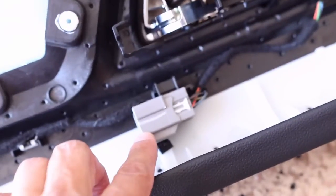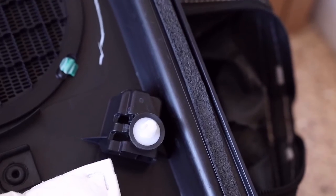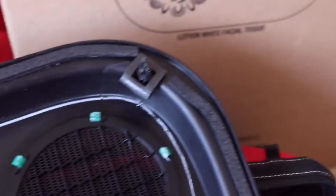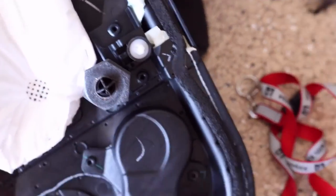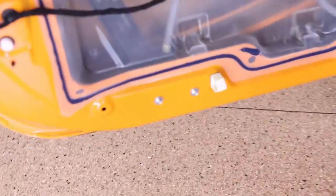Here's one cable assembly which looks normal. But this other black one is kind of deceiving — you see this housing that looks like where you push, but it's not. You have to push the little tiny plug on there to pop it out. Those are the little white clips I was talking about — there are four of them. If you put your tool in between the door around where those things are, you can pop them out. Just be careful so you don't break those clips — you've got to pry with a little bit of force and a sharp motion and it should pop out.